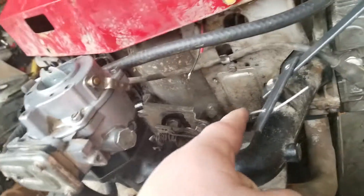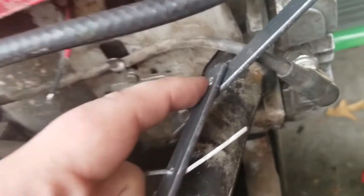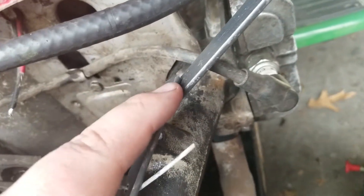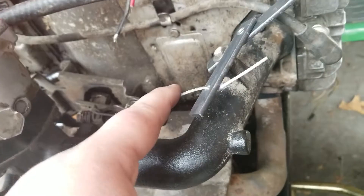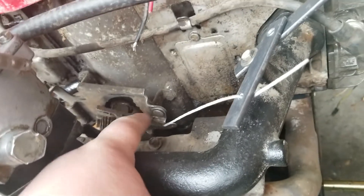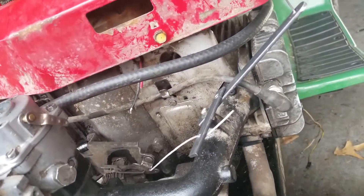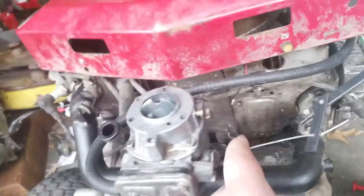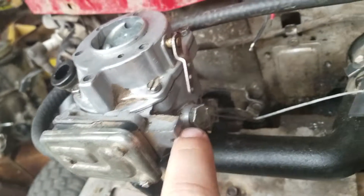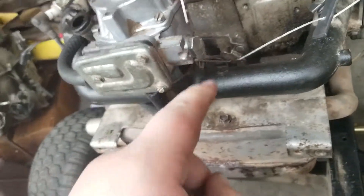This is my solution for using the original throttle cable — it's not done yet. As you can see this was riveted but it didn't hold, so I'm just going to weld that. This rod will go to here, and this is basically your throttle. There's a ton of flex in it so I don't even know if it's going to work — it's got to get fastened down right here somewhere. Once I figure that out I think I'll have a solid throttle and it will be the original. I also just need to hook up this choke and find a screw and washer for the hold-down.